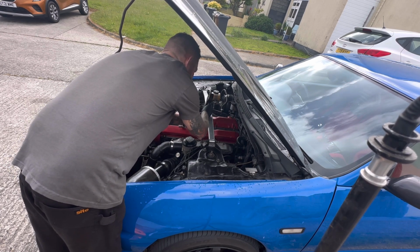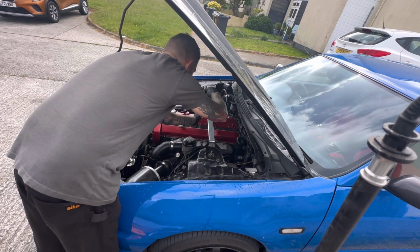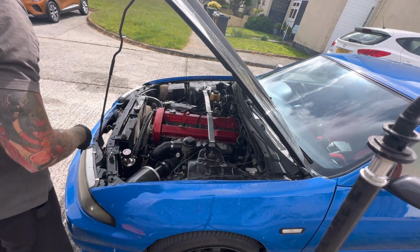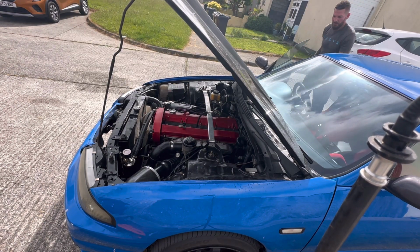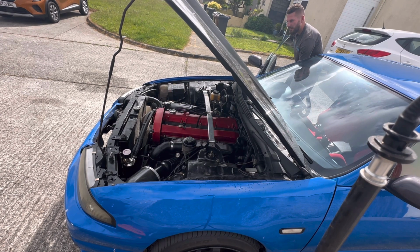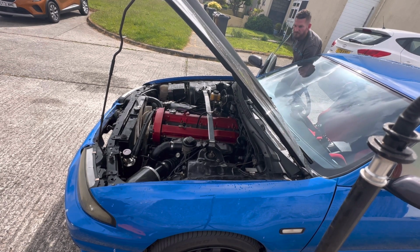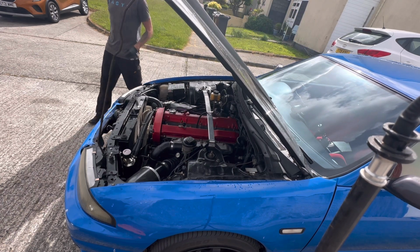So far they're all good. We got 6, which is at 9, and then all the rest so far are 9.5. So 6 is the lowest, but by point of a bar, so is it 0.5 of a bar? I don't know how bad that is. Car works, I ain't fixing it. Right, that's it. Do a couple of cranks and that is that. And hopefully it's between 9 and 9.5.